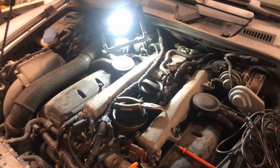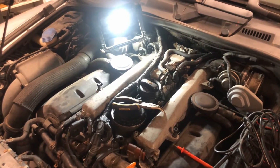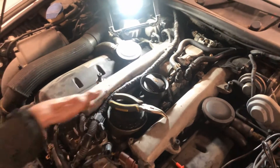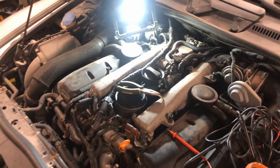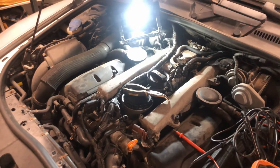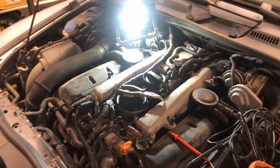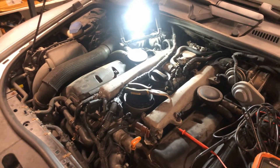If you're running into an issue with the V10 and you have to do glow plugs, the intakes will have to come off to get room in there because they are recessed in pretty far. There are also a couple of different revisions with the glow plugs, so I'll cover those differences before we get into the test.